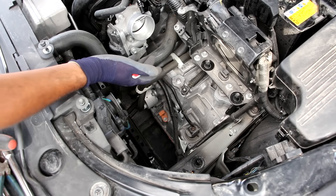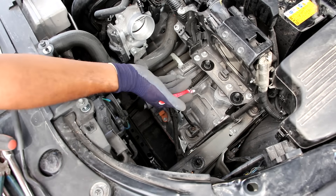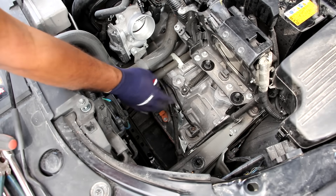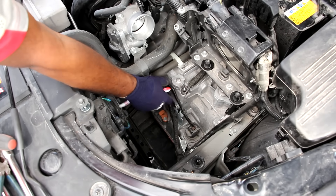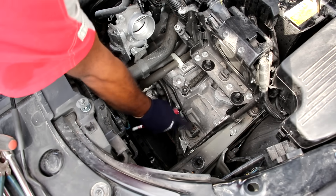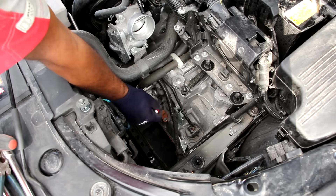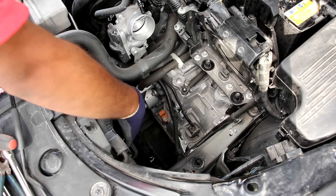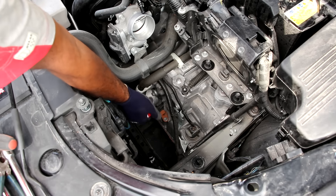Taking a look at the transmission on the CX-5, Mazda has chosen a very simple method with just a six-speed automatic transmission — most other automakers are offering CVTs or even an eight-speed automatic. The top of this transmission has a shift linkage; there's no electronic shift or motor that changes your gears for you like on a Ford or something. You've got a wire here that goes to the valve body, and down inside of there we have the transmission cooler with coolant lines. So instead of bringing ATF out of the transmission into the radiator it's all self-contained inside, which is less prone to leak.